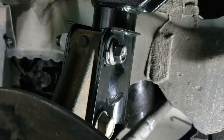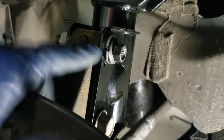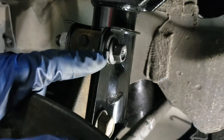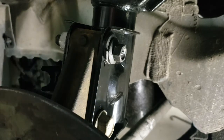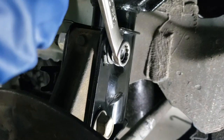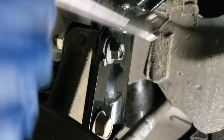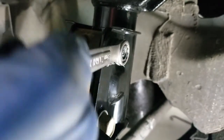As I was talking about earlier in the video, we did add a front camber kit to this car — I'll show you what it consists of. This is our front strut when we were putting the car together. All you do is remove the stock upper strut bolt and replace it with an adjustable elliptical-shaped bolt that has a washer on it. Depending on how you orient the washer and rotate the bolt, it will allow you to add or subtract camber. Once you do that, you snug it up, torque it down, and you're good to go.